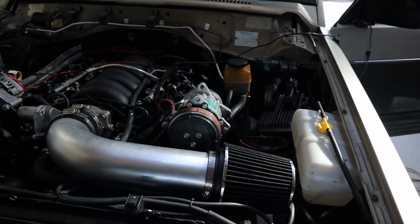And yeah, start really finalizing a lot of the stuff in this car and getting it buttoned up properly. The other thing is, we were hoping to get it somewhere to get these AC ones sorted this week. Now that we know that this miss is caused by an injector, we're not too keen on driving the car anywhere, because obviously the injector problem means it's running lean on one cylinder if it's missing. If it was just a coil problem, we wouldn't have been too worried. I would have been happy enough to take it up into town.